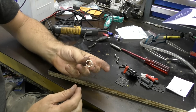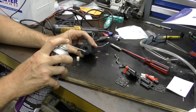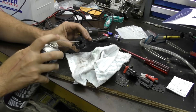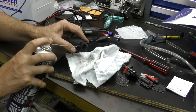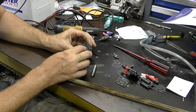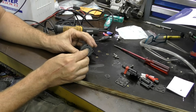I'm going to spray this now with a bit of brake cleaner and some compressed air, then use a little bit of carb cleaner to clean this out. Cleaned out with carb cleaner, filter back in, and then the center pin for the solenoid back in.